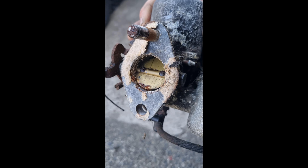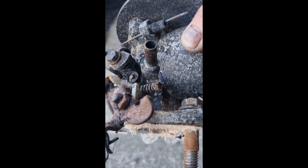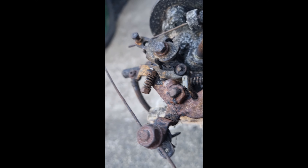What have I done? Right, so I managed to get a fire off. I've done it with my hand over the inlet, bit of brake cleaner, and she fired and she ran. I had to take the carb off because the carb, as you can probably see, is a tad bit solid.